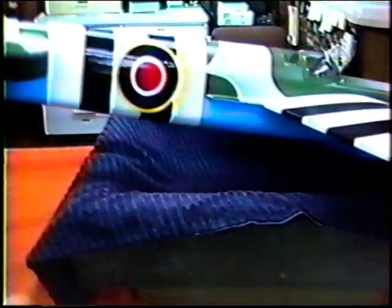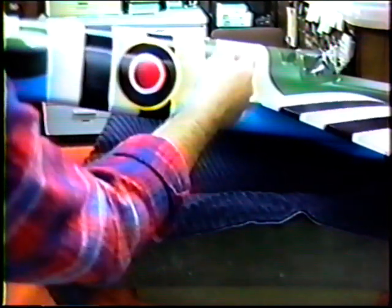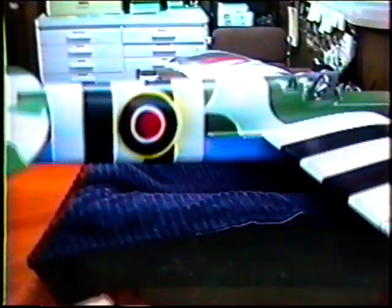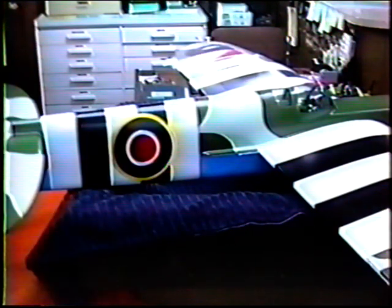Now, this is just some M600 to clean this up. A good tip here, rubber cement doesn't last 10 hours. When you do a rubber cement job, what I'll do off camera, I'll go mix up the yellow paint, put it in the gun that has the lightest color, clean the gun and get the gun tested and ready. Because the trick is I want to get the rubber cement on, get the piece in place, put some foil around it, shoot it, let it dry, and then go around and do the other side. I don't want to put the rubber cement on and then spend 45 minutes, an hour, doing something else. I want that cement to sit down as nice as possible. So you've got to kind of work through this. I would say you probably could leave it on for an hour, but you certainly don't want to leave it and at the end of the day come back. It won't be as good as if you do it quickly.